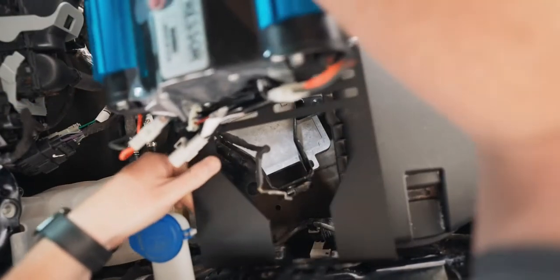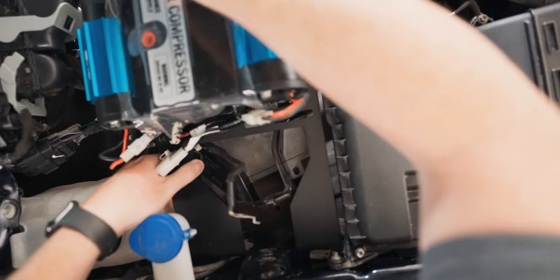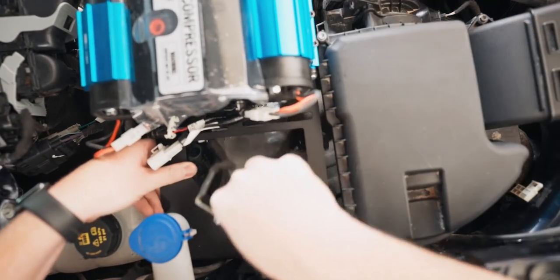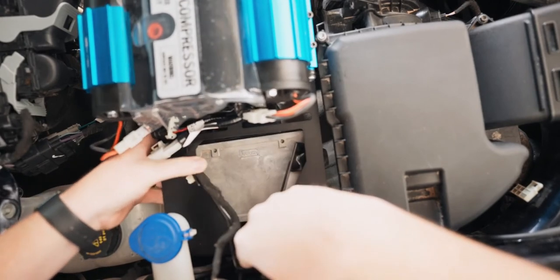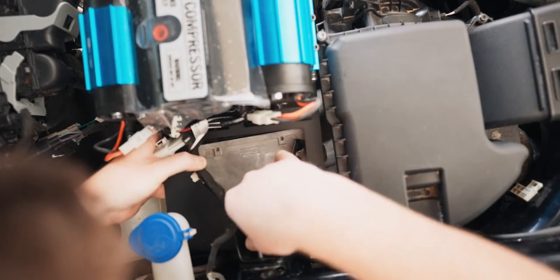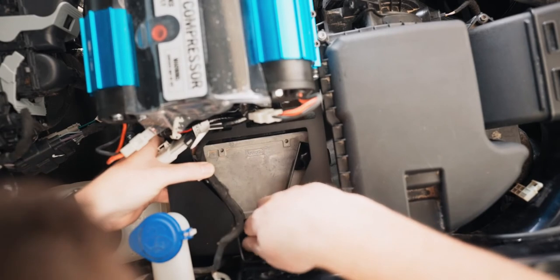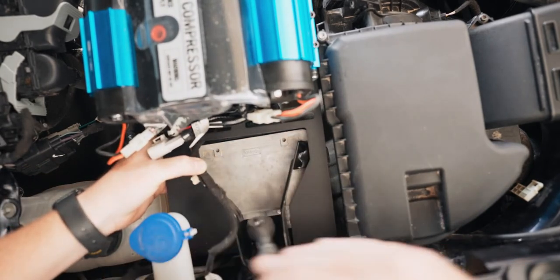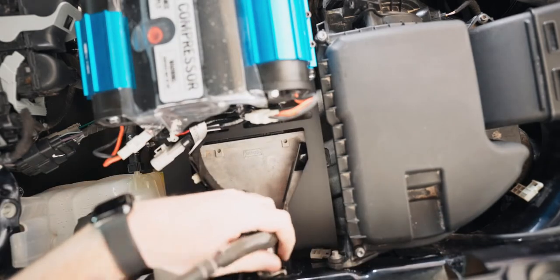The mounting plate will sit between the body of the Bronco and the computer module bracket that you just removed. You can place the mount with the compressor mounted to it in the engine bay and then just rest it on that newly installed leg attached to the shock mount. I found it easiest to start with the top bolt of the bracket first, then the bottom, then the ground. Once all three were finger tight, I torqued them down just back to their normal spec.